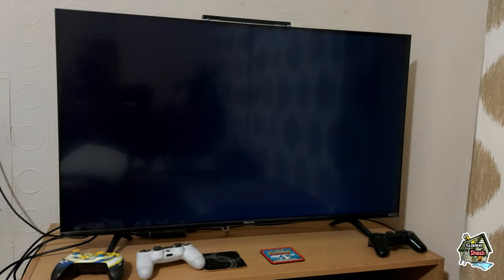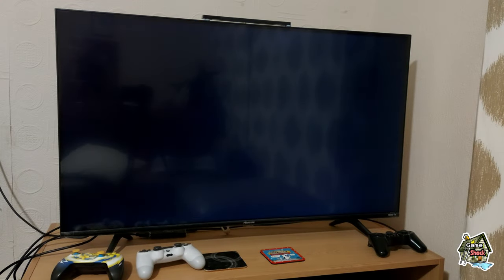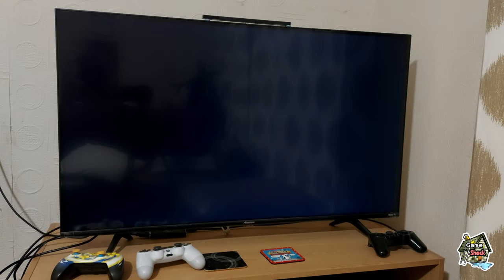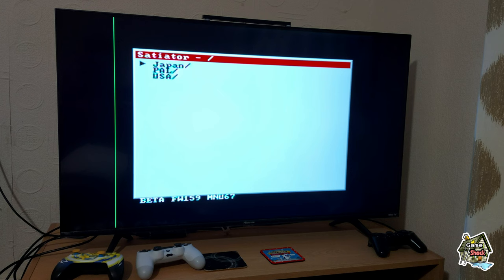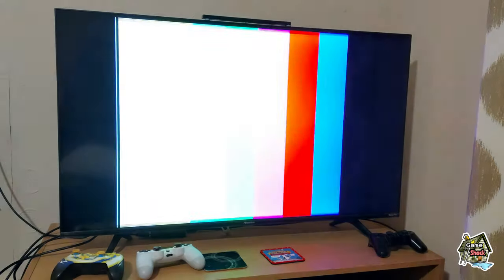We had sound — let's change it again. This is RGB passthrough — okay, that sucks. Wow, this is really promising, isn't it. We've got some picture on composite but the colors are all wrong and we've got a bar down the side of the screen. If you just touch the cable it's really loose — it's really bad fitting.